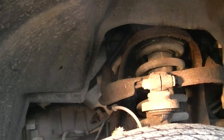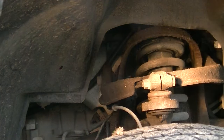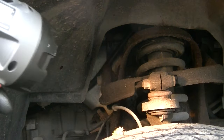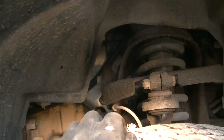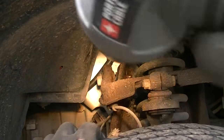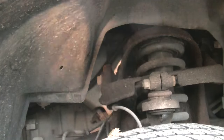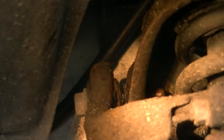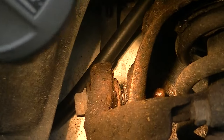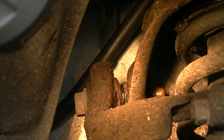Now, if you look here — I've got my light out here today, it's kind of a cloudy, dark December day — you can see the upper control arm here. I replaced the upper ball joint and everything seems really good. I can sit here all day and shake this wheel and it is stiff as a board. So I got to looking up in here, and I wanted to see maybe one of the bushings on the control arms is bad. The pulling seems to be on the passenger side — check this out right there, folks. You see that right there? That's a bushing, and that's an upper control arm.